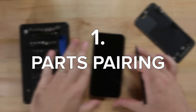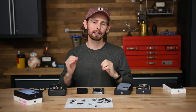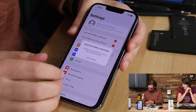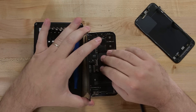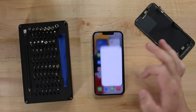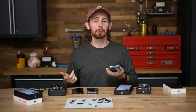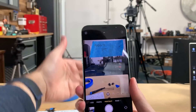And finally, we've arrived at number 1: parts pairing absurdity. We saved the worst for last. The iPhone 13s are still victims of Apple's attempt to monopolize their repair. In our livestream, we were able to perform a battery swap, which felt like a win, since some rumors were claiming an iPhone 13 wouldn't even turn on with a foreign battery installed. But that small victory didn't last very long. After a long day of extensive testing, we and some others found that despite the simple new display replacement procedure, any display swap we performed — even transferring the original Face ID hardware — would disable Face ID completely. This behavior feels buggy, and it's possible Apple could fix this with software, like we saw last year where camera swaps between iPhone 12s would cause the camera to glitch out until a later software update.